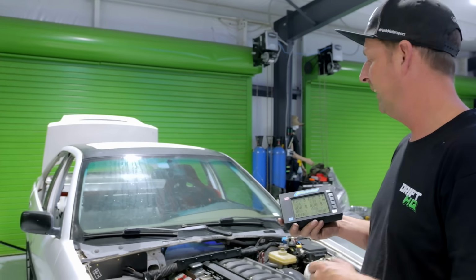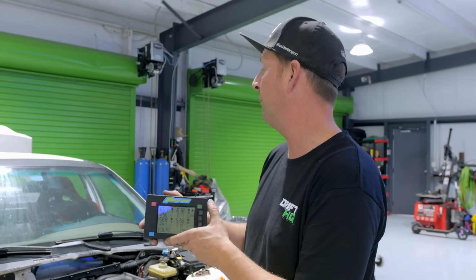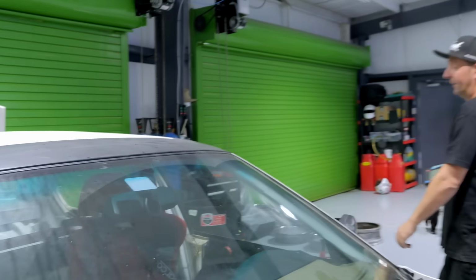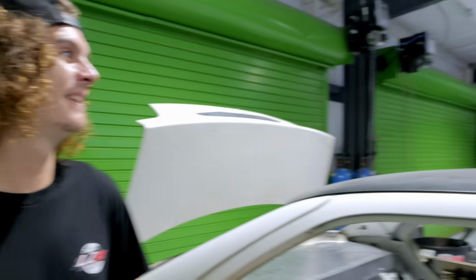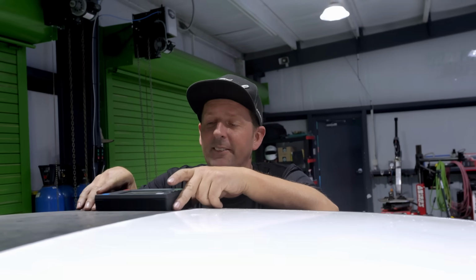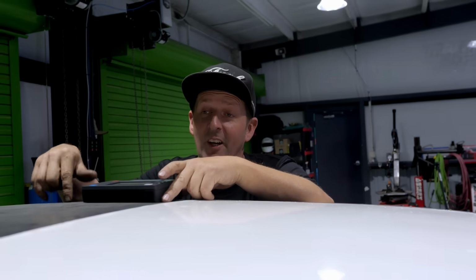So yeah, you could have your car under 2,300 pounds, or 2,400 pounds, if you don't have a harness bar and a speaker and you gut it like we do. Also, mind you, this thing only has like an 1/8 of a tank. So we were not able to test the car because of weather. You know, Florida. We got rain all the time. It's not that we're scared to drive in the rain, it's just you really can't get a good comparison because when we tested it with all the weight in it, it was dry cement. And wet cement handles completely different.